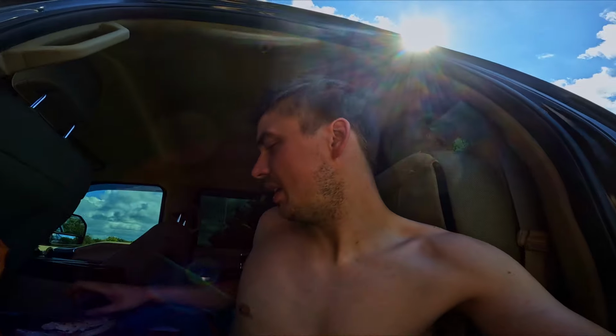I'm running 32 to 1 in it, which I think might just be a little bit much. I'm thinking about stepping down to 40 to 1 and then definitely drop down the pilot jet and then maybe move the needle down one too. But yeah, I'm just taking lunch break, a little sub sandwich, and gonna get back out there ripping.